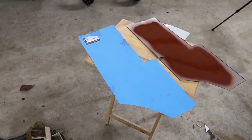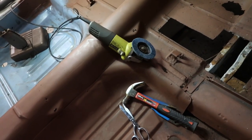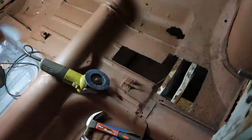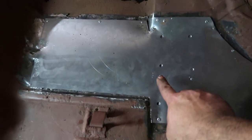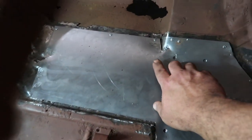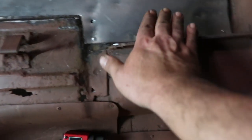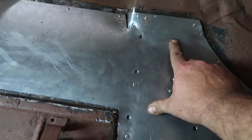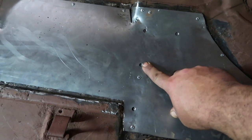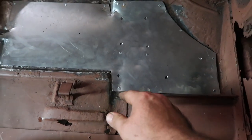So I've taken my template I cut out. I've got that drying with the primer on it right now. Then I'm going to take this flapper wheel and clean up all the lines where I'm about to weld. I've got the panel put in and I just did a few pop rivets just to hold it in place. That way I could form this corner right here where I did the relief cut, right there where there's a hump, and kind of get it to contour on the frame rails. These holes I drilled for the spot welds are just sitting right on the frame really flush — there's no give in the panel at all.